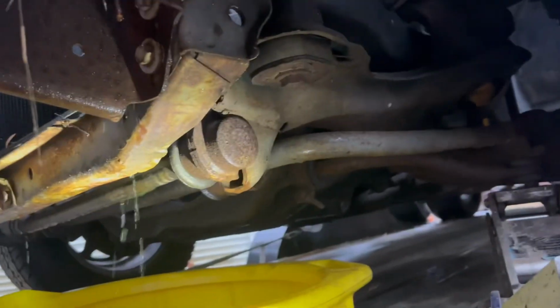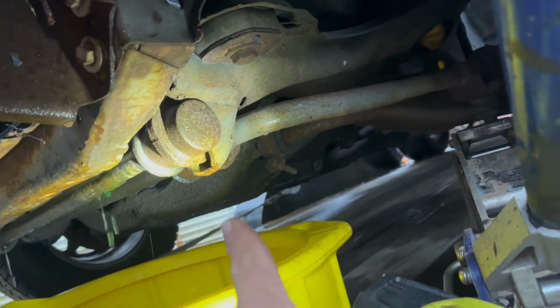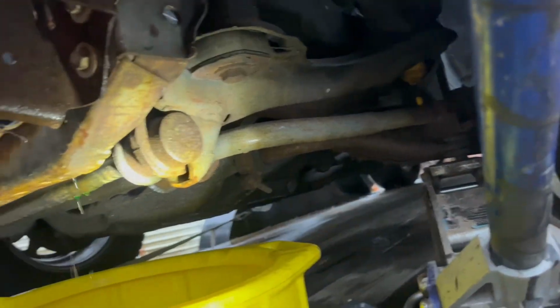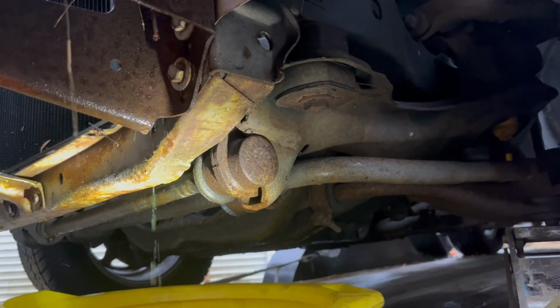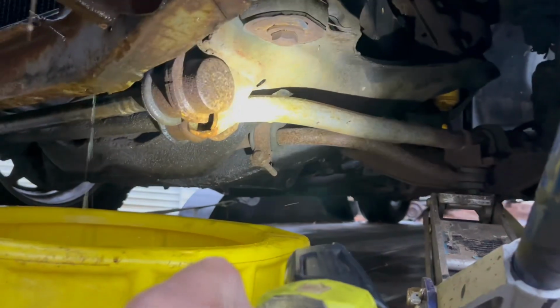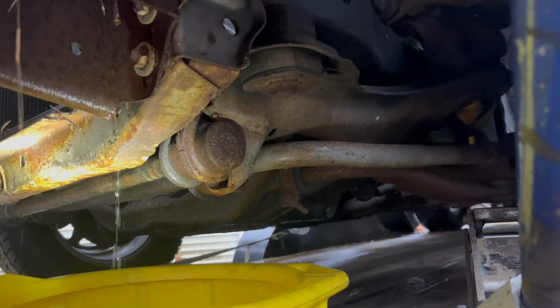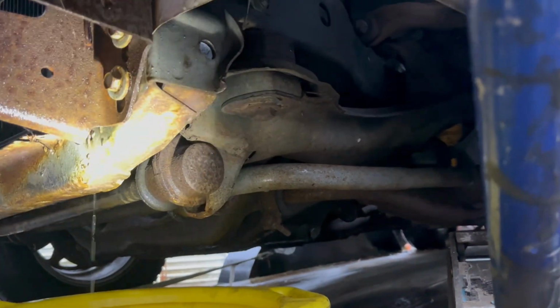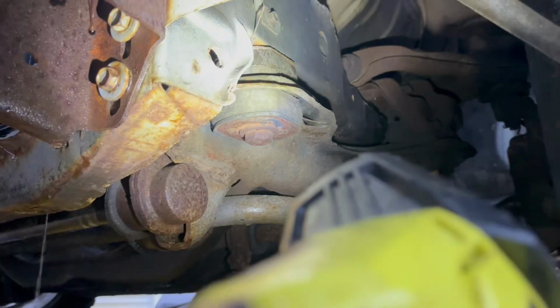Another thing, this car has the torsion bars that go sideways. See, this is the end of the torsion bar from the passenger side, and this is the torsion bar here, and it curves around and goes over to the right side. It's called transverse torsion bars, and of course, that's right in the way of where the petcock needs to be draining. Normally, the torsion bars on the regular Chrysler go in the back of the lower control arm right where it hooks to the chassis, to the K-frame, and then it runs straight back about three foot or so. But this is supposedly an improved design. I seem to like it. They seem to handle a little better, but they got a lot of rubber bushings on it for ride. You can see right here are the rubber bushings. By the way, those look pretty good.